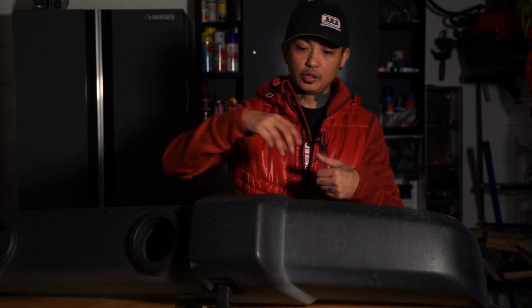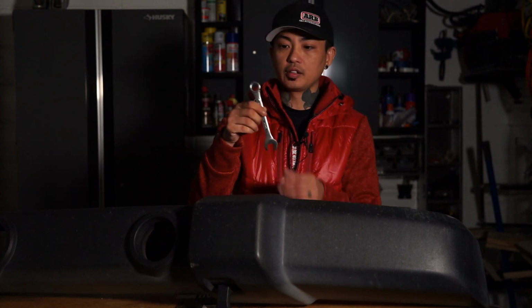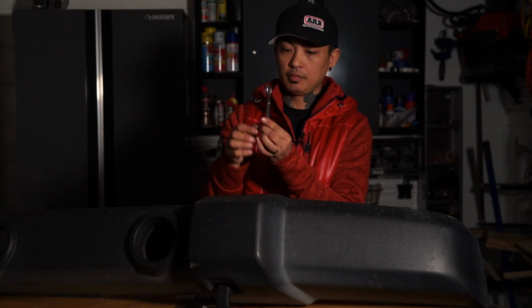It's hard to get to those bolts. The ones on the inside are easy, you can access them. But on the side, ARB was saying that we need to use some sort of tool to put that bolt in there so we can reach it. I didn't know I needed it. So what we did is we took a wrench, something similar like this. We put the nut in there, and then we held it in place with painter's tape. And then we just slid it into that slit,